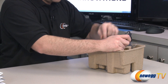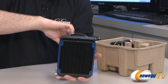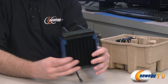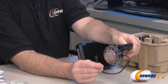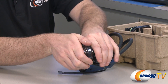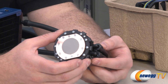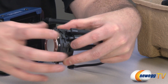Also we have the liquid cooler itself — a closed loop cooler and radiator. As you'll notice, the radiator has all the aluminum fins, with a thicker side versus the 120 millimeter wide side. It actually has blue caps on either end, which is unique — I haven't seen that before. Here's your rubber tubing going over to the cold plate and the water block. You get a three pin connector to provide power to the pump inside the water block. There's your copper cold plate — it comes with thermal paste pre-applied, and the teeth are used to install it. Once you have the mounting bracket installed you simply pop it onto your motherboard, twist it, and it locks into place.